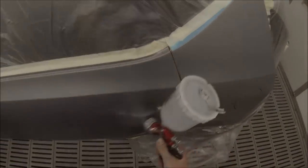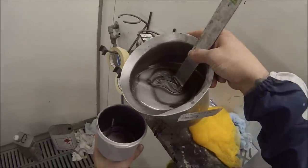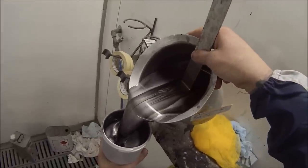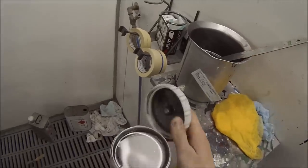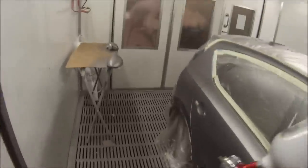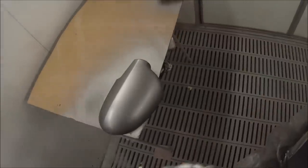I'm using solvent base, and it's 25 degrees in the booth, so by the time I've got back around and done the bumper bars — I've actually skipped the footage of the bumper bars to stop the video from getting too long. I'll put one coat of clear coat on the bumper bars at the end. If you're still interested in watching, there's one coat at the end.